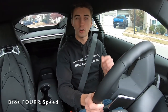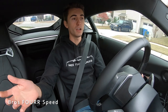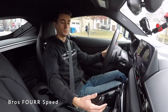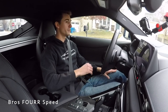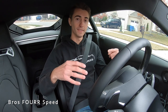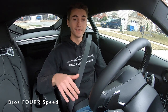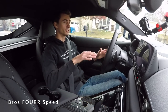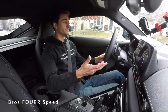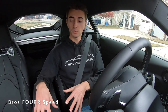Don't park the car on the transmission. So I'm on a hill right now — I'll come to a stop, put the car into park, and take my foot off the brake. Notice we rolled back just a little bit. When you put your car into park, there's a pin that locks the transmission. Right now I'm basically putting the weight of the vehicle on that pin inside the transmission. When I go into drive, I feel the car jerk just a little bit.